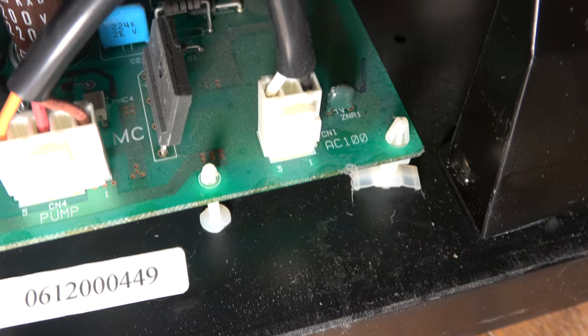It appears that I was wrong. It is not a 5.2 volt Zener. That is not a standard voltage anyway. I think that's not a 5. It's a 6, so it's 6.2 volts. That's a diode that I need to obtain. I mean, you can argue that it's not needed anyway, but I'm going to obtain a replacement 6.2 volt Zener. What wattage do you think this is? Let's see if we can get a 1 watt, I think.